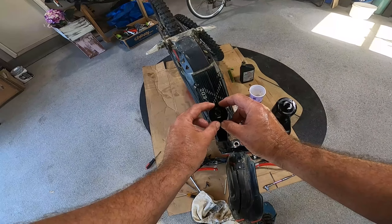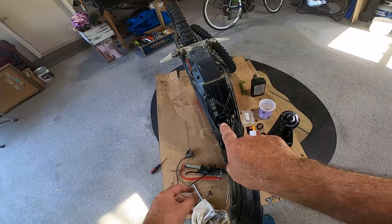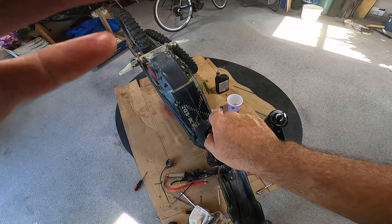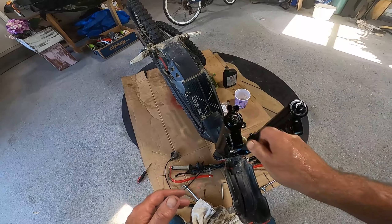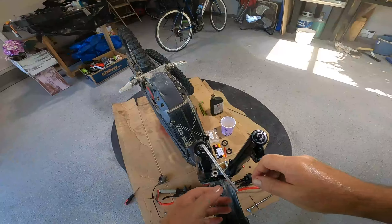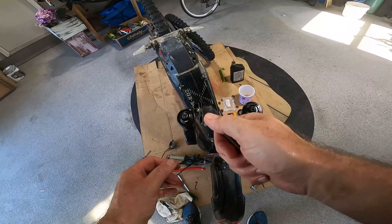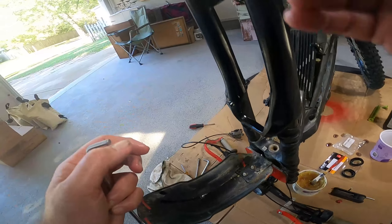We have success — the rod came through the hole, and the female threaded rod is right there, so I'll be able to put the nut on pretty quickly. The one thing that centers this rod so it lines up with the hole is that washer — there's a thicker washer that goes lower here that mates with the upper part of the fork. I pushed that washer all the way to the bottom of the lower to line up the holes of the female threaded rod. Hopefully we'll be able to thread this, and if so, we'll be in good shape.